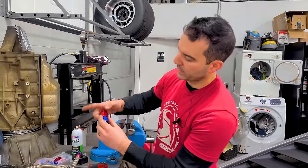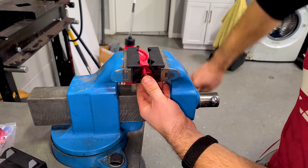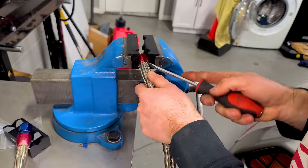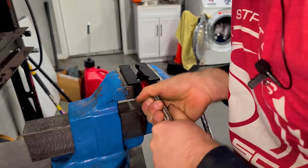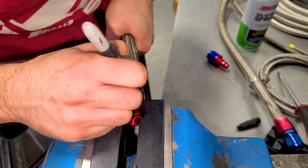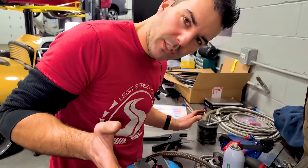What we're going to be using on the Cobra is exactly what it had — steel braided rubber nitrile lines with a rubber liner inside. These are much more heat resistant because of the steel braid and will hold a ton of pressure as well. To get the fitting onto the line, we start by unscrewing the end. These are magnetic jaws for your vice to hold the fittings so you don't scratch them. Use a little bit of silicone spray on the end to make this easier.